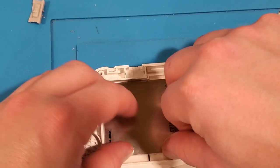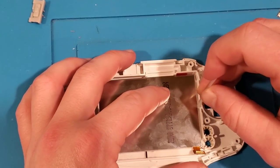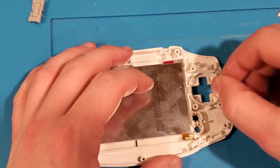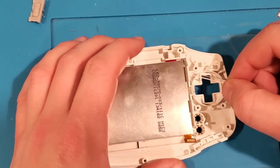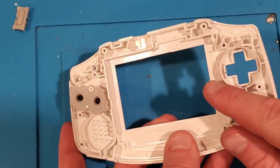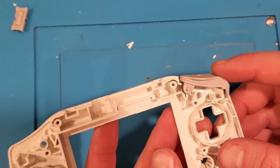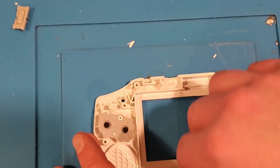So I'm going to use an original size lens without modifying the window cutout. I don't really trust that I can make a cut nice and straight, and I don't have a great tool for that. We've already done the vertical centering using the wider bracket. They've also included this little horizontal spacer which would go along this side where the buttons are. However, as you can see, this doesn't really fit in yet — it's too thick. So what we have to do is remove a bit more of this plastic right here.